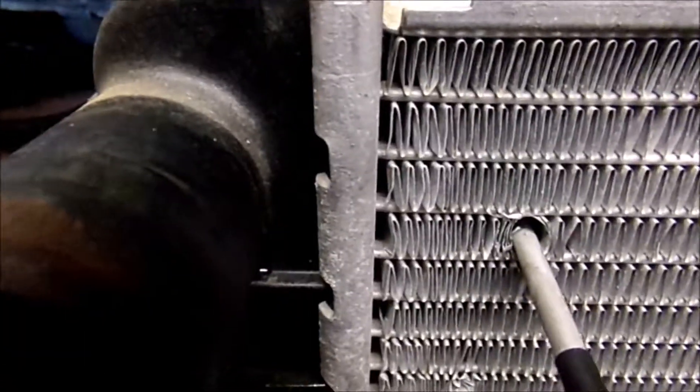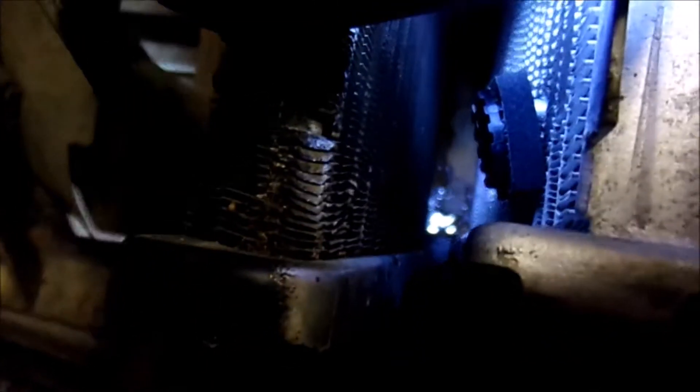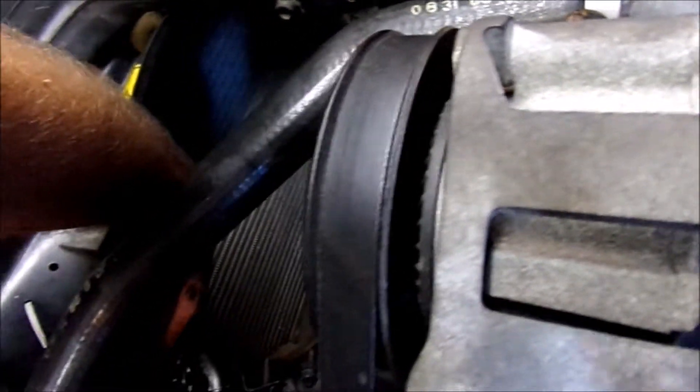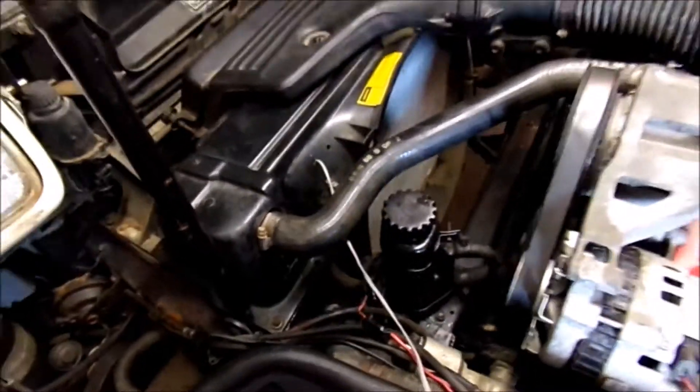This will mount through here and the other side will zip-tie tight so it won't move. This is close to the inlet, and there was a little bit of fin material that came out but I gently used the tool and reamed it out a little bit. Hopefully we did not puncture a core. The back side stop on it is just a zip tie that runs in beside it. Hopefully we're down low enough and didn't pierce a radiator core. I went ahead and started the car, topped the radiator off, put the hose back on — the radiator's good, we don't have any leaks. We didn't damage the radiator.